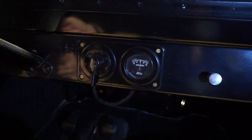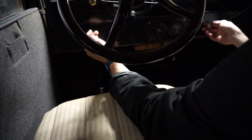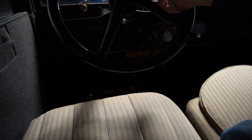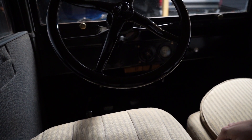It is a little cold. All right, we're going to try to start it here. There you go — you've got to put the timing down a little bit and it'll smooth out. There you go, just smooth right out.